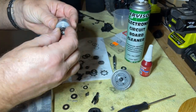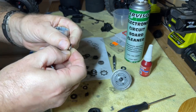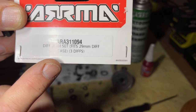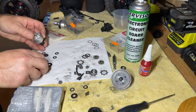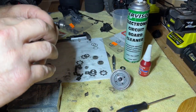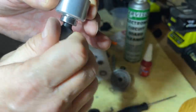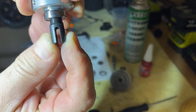What I've had to do is put it all back together to get that movement out of it. I got another pack of shims from my hobby shop, Hobby Tech Toys — part number 31109-4 — these are the open diff shims. To get rid of that sloppiness I put two of the large ones and two of the small ones in there. You can see the pins in there now and it spins quite freely — no movement at all. That is perfect.